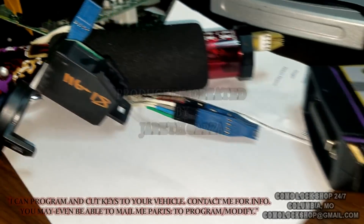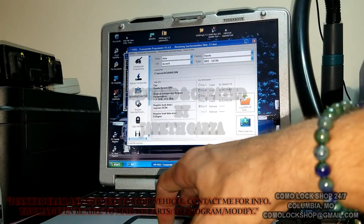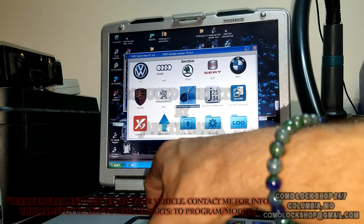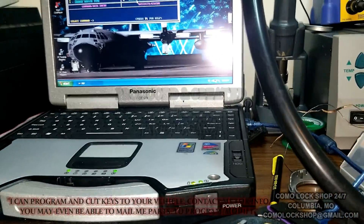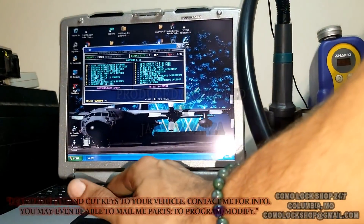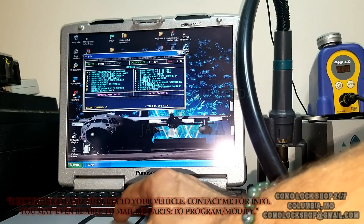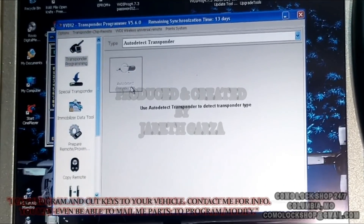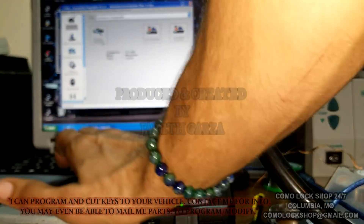So it's still clipped. I'm gonna go ahead and exit. Actually, let's read the transponder now. I haven't moved it, it's still in the coil of my VVDI 2. Now we're gonna auto detect it real quick and see what it says. It is now locked — it once was unlocked, now locked — which indicates success in my opinion.